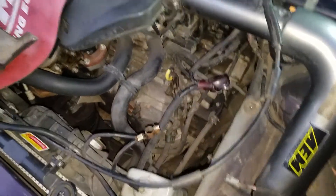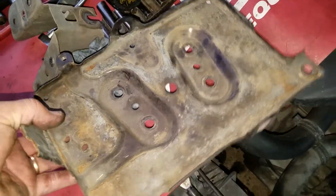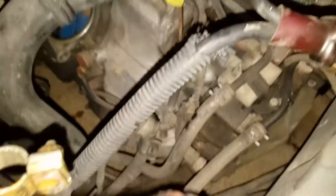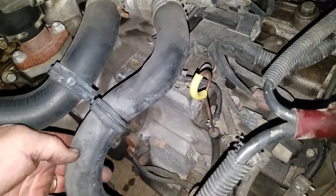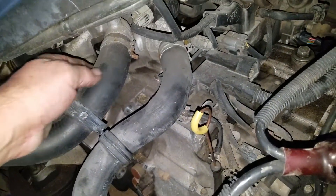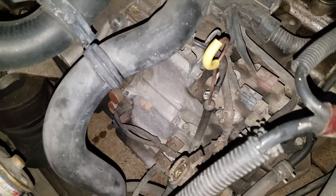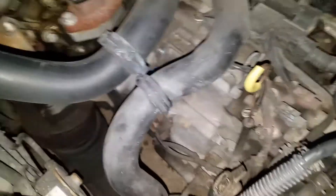This is a good time to refurbish your battery tray if it's all rotted and nasty. This one's in pretty good shape, but sometimes they're in pretty bad shape. Clean it up and fix it. Have a look at your cooling lines — if you have an oil leak anywhere, the oil will destroy these hoses. These hoses are pretty old on this car, but you can check them to see if they're swollen or have a weak spot. These all are in pretty good shape. Pretty old car, so a lot of this has probably been replaced. Just getting the starter sorted out. Anyway, that's it — y'all have a good day.